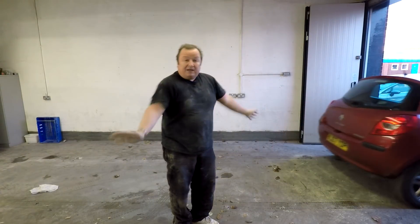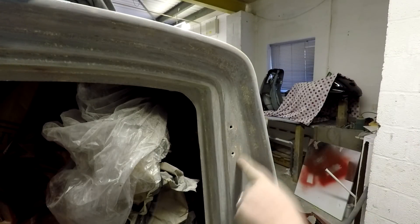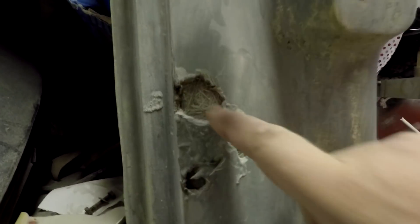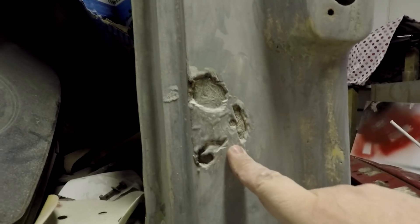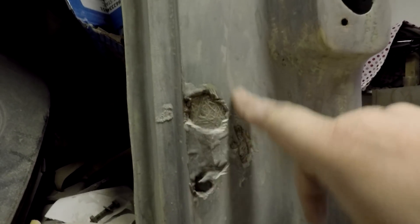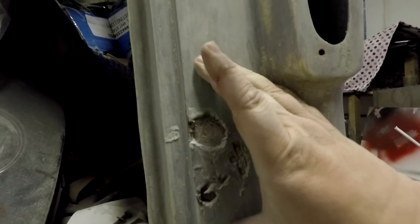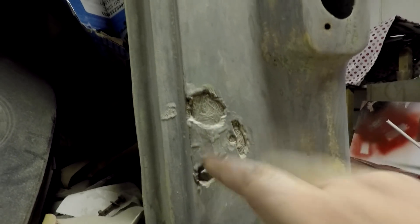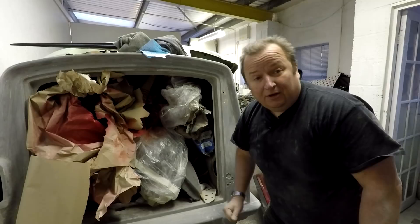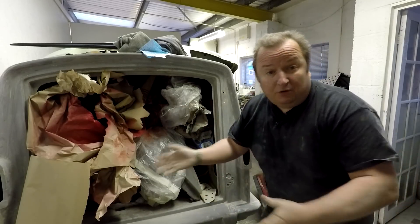We've just got to move things about now. Coming towards the end of the day, we're going to pack up. I've done a little bit of work on the Reliant Regal — I had a problem here where this was all cracked, and I've actually filled this with fiberglass now and smoothed that back off, so that's back to original. This panel down here had three cracks in it, and I've reinforced the back of it with some fiberglass — three or four sheets of fiberglass on the back now. There's resin you can see on the surface but this will be sanded flat. Someone had actually filled this with normal body filler — I've just dug it all out. I've got a metal plate to cut and fit on the back there, and then I've got to recreate these holes. This will be fiberglass filled as well, and that'll be a strong repair where both hinges are going to be fine. There's also access to the back here for me to put a little metal plate in there as well, so that's going to make that nice and strong. Jimmy's still using it as a skip for all his old paperwork. Anyway, better go out and give Jimmy a hand and move things about.